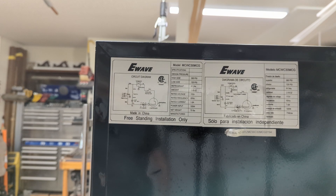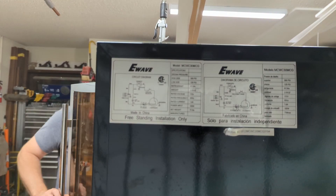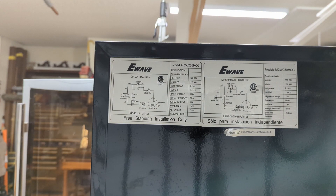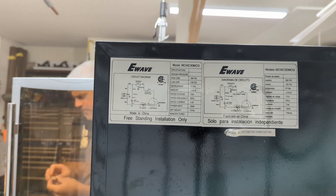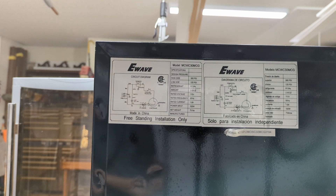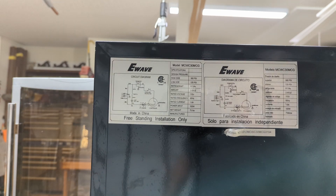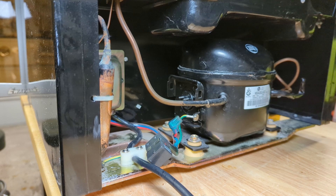So let's try to piece this thing back together. Because someone touched it, we got to figure out where to start. Let me look inside the cabinet, just make sure the control is all one piece. Kind of looks like it is - doesn't seem like anybody tried to mess with it. It's an on/off switch. So I'm guessing someone was messing with the compressor. I'm going to go out on a limb and venture it wasn't starting. So let's start on the back by the compressor compartment with a resistance test on our compressor terminals.